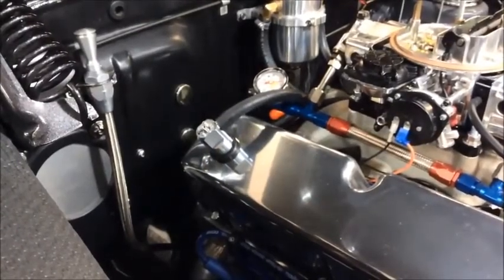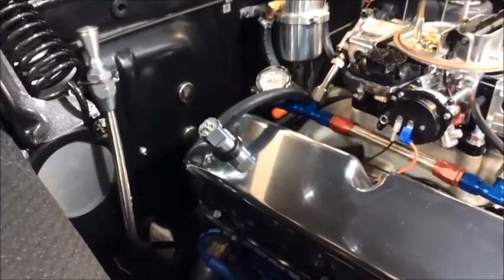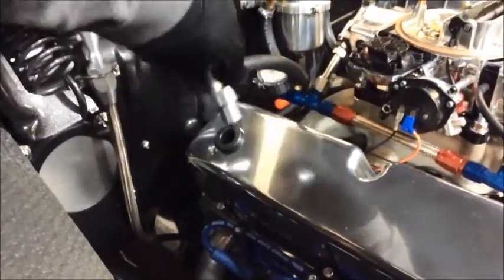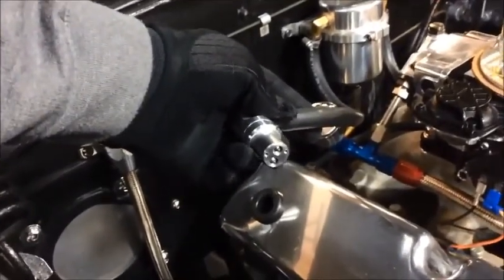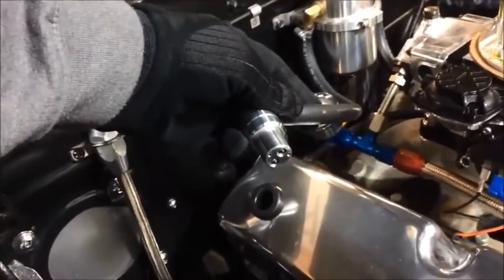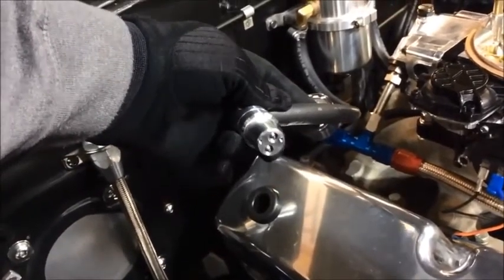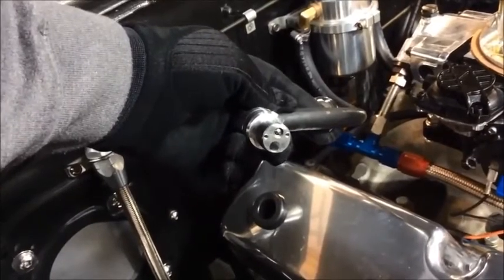Okay, so we have our valve, which is in dual flow mode, installed on the engine. Again, the first thing you'll want to do is remove it from the valve cover. And again, we'll check the idle ball to make sure it moves freely in its bore from end to end. You can see here that it does. The next thing we'll do is to start up the engine, and you'll see that the idle ball will retract all the way up into its bore from the engine vacuum.